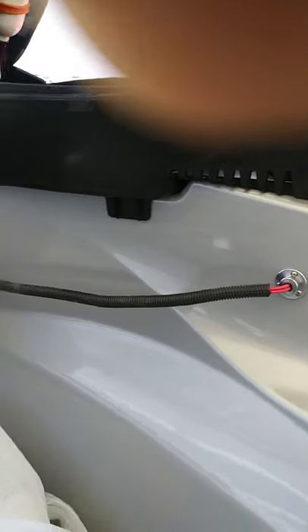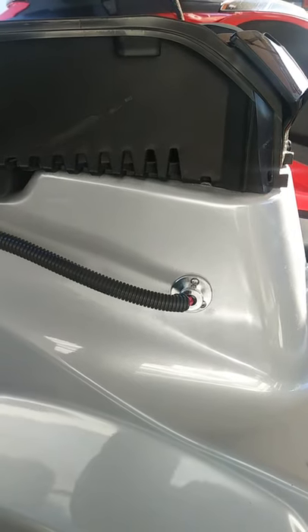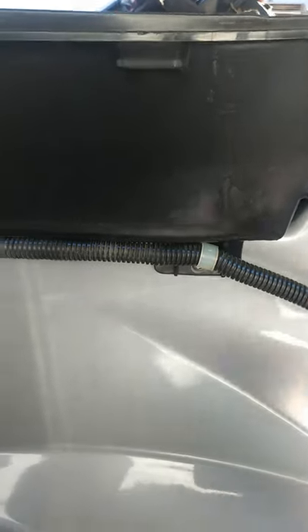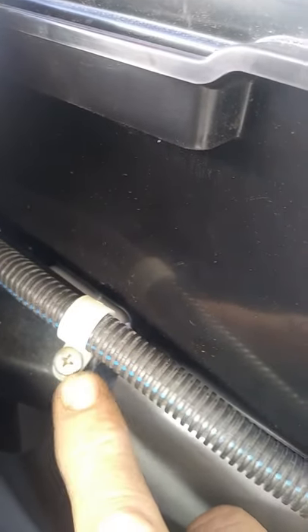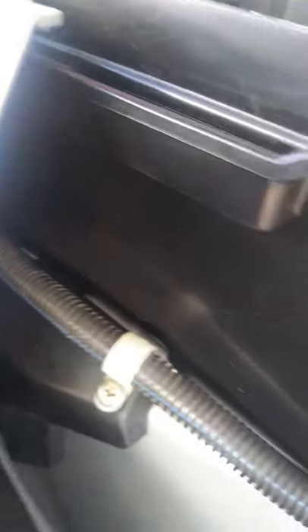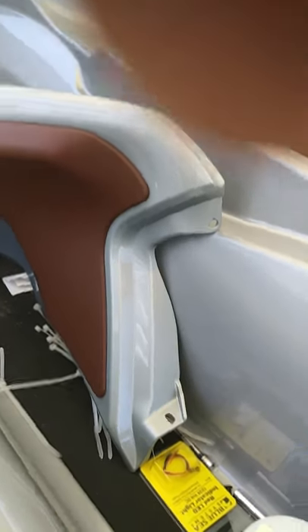After securing the cable and making it cosmetically clean, we finish up the electrical with P-clamps going right in here — stainless steel fasteners, quarter-inch by number eight and a half inch P-clamp.